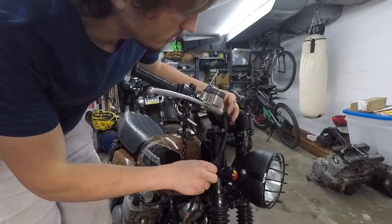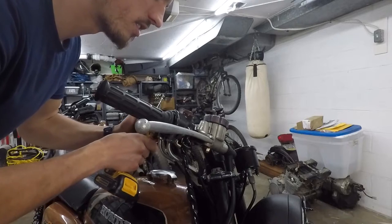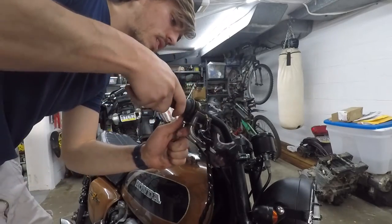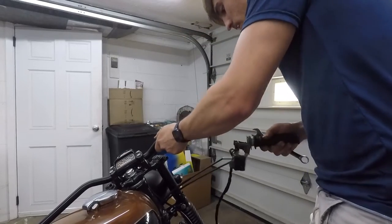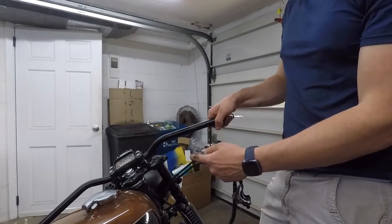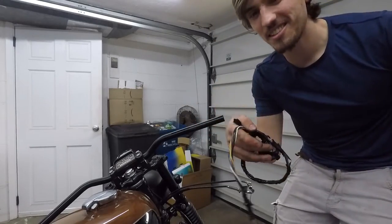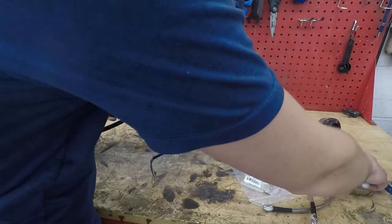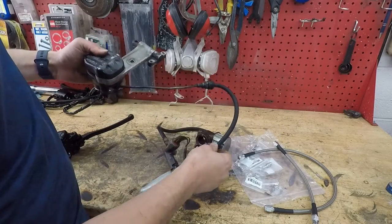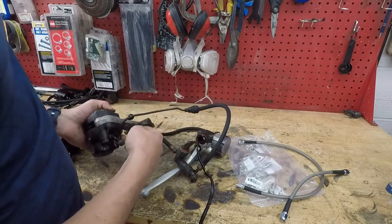Since I'm putting a new master cylinder on this bike, I'm going to go ahead and remove all this stuff because I'm replacing the throttle and the controls too. We've got the old right-hand controls removed. I've got the whole front brake system removed — the master cylinder and lever, then the rubber hose, the other rubber hose, and this steel brake line. This is also an upgrade because we're eliminating that steel brake line.